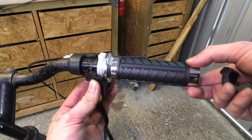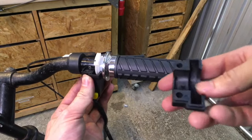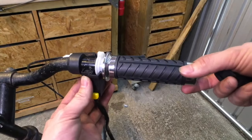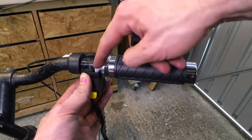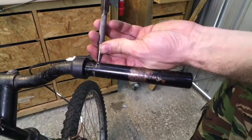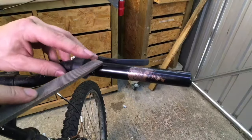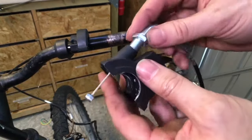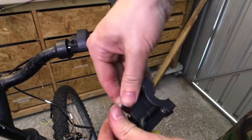For the kill switch, you want to pull the actual mount up as far as it will go so you don't get too much side movement. The top clamp has a pin in it - you need to drill a hole in here. Make sure you get the kill switch at the right angle where it's easy to get to. You can put some white lithium grease inside here so it doesn't wear out as quick. Install the throttle cable before you install the throttle mount - wind this in and tighten the nut up against the plastic so it won't move.